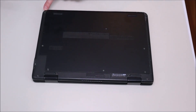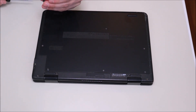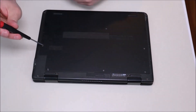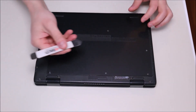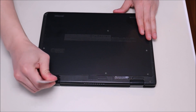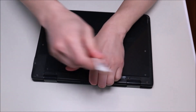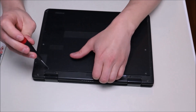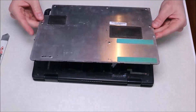To get this piece of rubber out, I'll take a small flat head screwdriver and just stab it right down in there, pry it out, and try not to damage it too much. These are usually just held in with double-sided tape — they'll pop back in as long as you don't damage them too much. After taking out all those screws, we're going to take our flat pry tool, go across the seam, and pick it up. And that comes off like that.